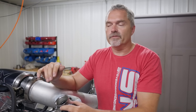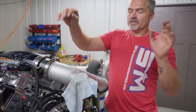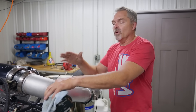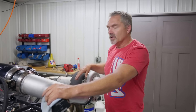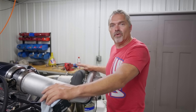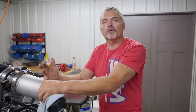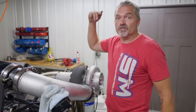What I did here too is I kind of bolted and taped on this rag, so we shouldn't see this thing shooting up like this when it is speeding up the turbo. Now, don't do all this stuff on your car. Don't put wastegates and stuff on there until you have turbo speed sensors, because you can overspeed the turbo. If I left this thing open and just revved this thing all the way up and never closed this, it would overspeed the turbo. It just does. It doesn't have any restriction to go against, so it just freewheels up — it has all the drive pressure and just freewheels like crazy.